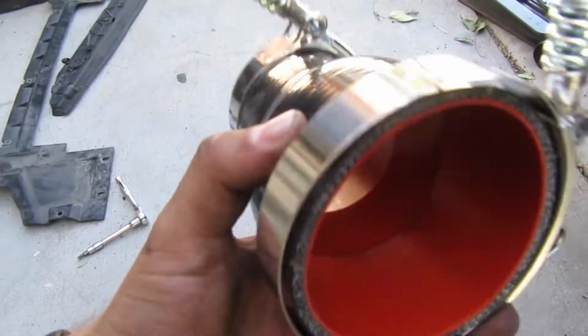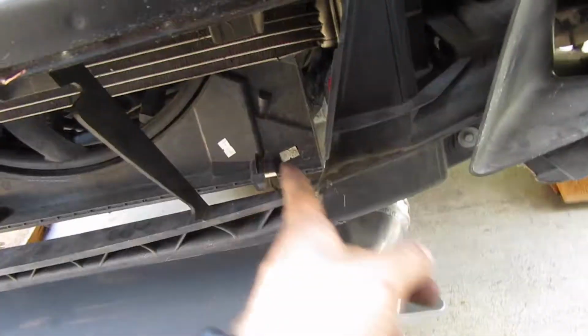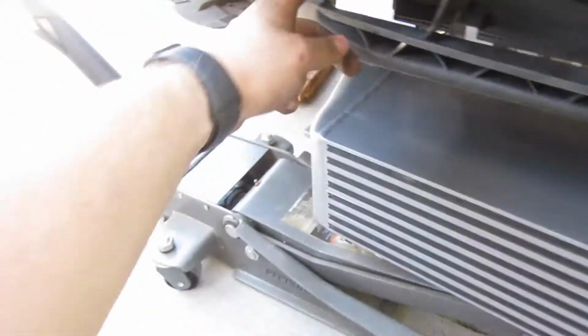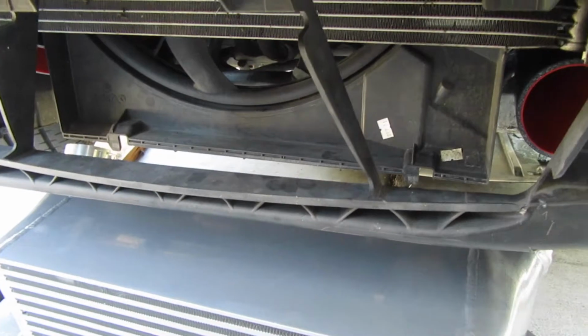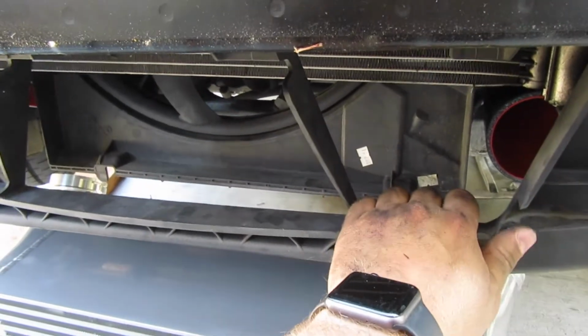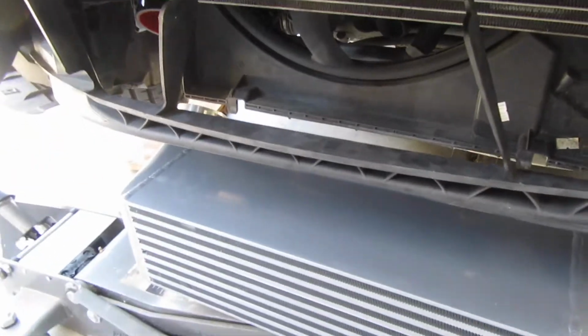Now it's time to just add this guy in, which is this side slips in, and then we put the intercooler in. Also, I had to end up taking off the bumper because you had to kind of cut from here to here, cut this out, maybe these pieces out too, to make it fit. Unfortunately, I cannot find my Dremel, so I'm trying to just hit it with some scissors and a knife. Hopefully that works. I'll get back to you guys when that happens.